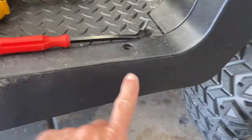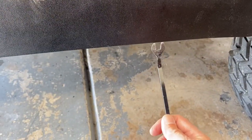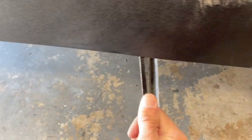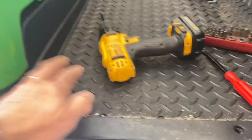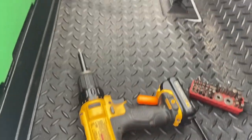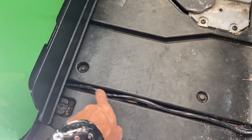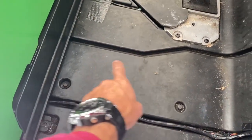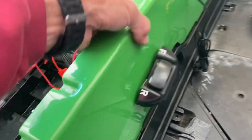When I take those side plates off I generally like to use a little tool like this. It does have some small plastic retainers which can break, so if you can squeeze it underneath there just gently pop it loose. We're going to pick this floor mat up — you can see it's loose enough where I can squeeze it out. I'll do the same to the other side. All right, we've got our floor mat up. We're going to need that because we're going to run a signal wire up that track to the dash.